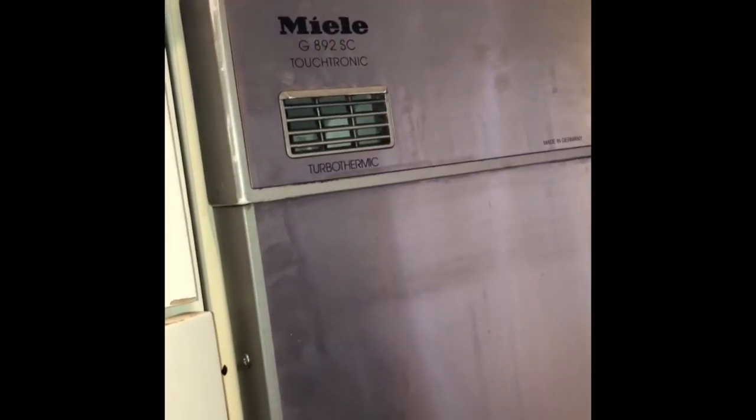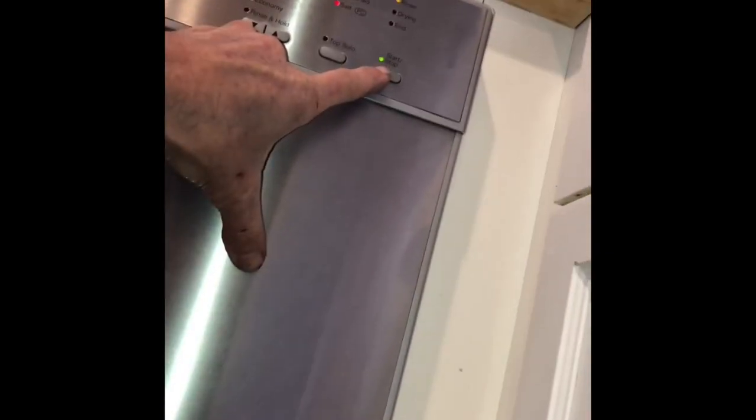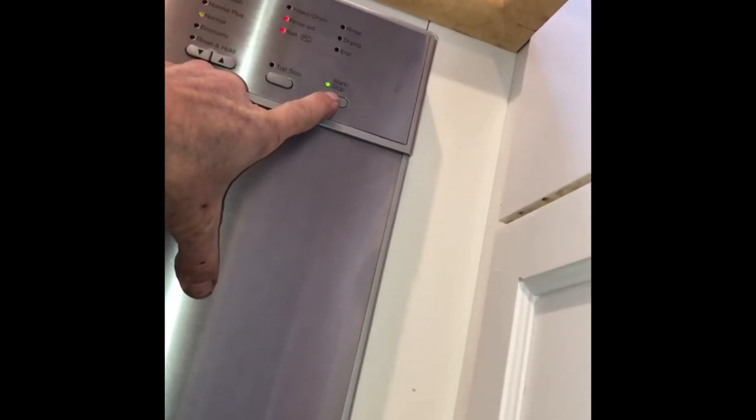So this is the Miele dishwasher, so it's got water coming in fine now. The water level should reach up to the bottom of the triple filter white handle. Then you know you've got the right amount of water coming in. So this one looks great. So the procedure worked really good. Only takes about 20 to 30 minutes. And you'll save almost $200.